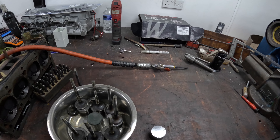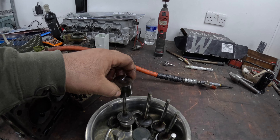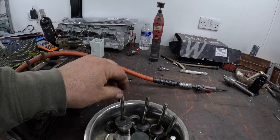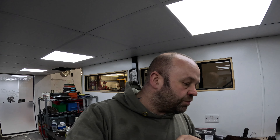The shim sits on top of the valve stem, then the bucket sits on top — that biscuit shim is how you set the valve clearance. So any work I do to the valve seat on the valve or the cylinder head will change the valve clearance. What I'm going to do first is give the valves a shot blast, polish the stem, reface them, and see if they'll grind into the seat. I'm hoping to save the customer money.